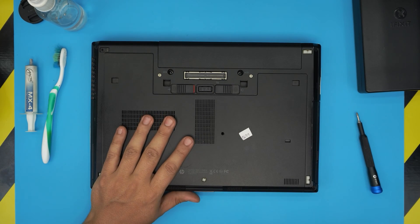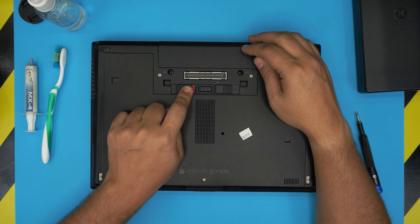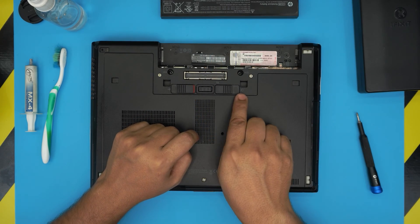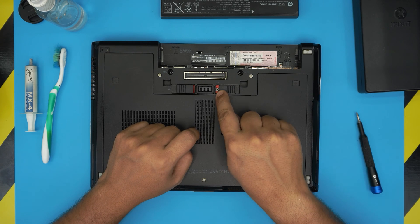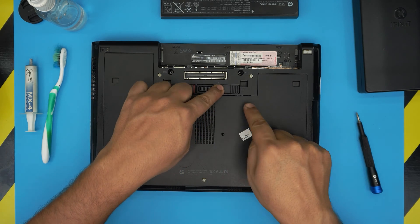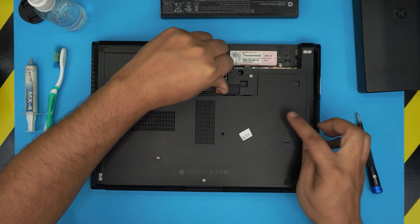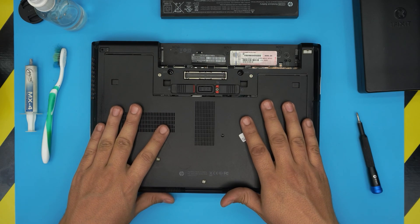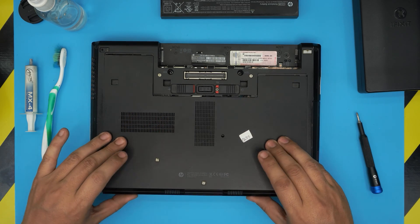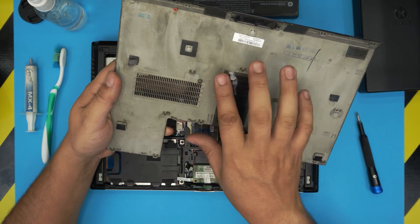With all this on hand, let's get started. First, remove the battery — it says 'battery' towards this side, so pull it all the way and slide the battery back to disconnect it. Next, remove the cover: pull it this way. If there's a tiny screw, remove it — this one doesn't have a screw. Once you pull it back about half a centimeter, lift the cover up from the front side. You can use a toothbrush to clean up the dust mesh and everything on the bottom cover.